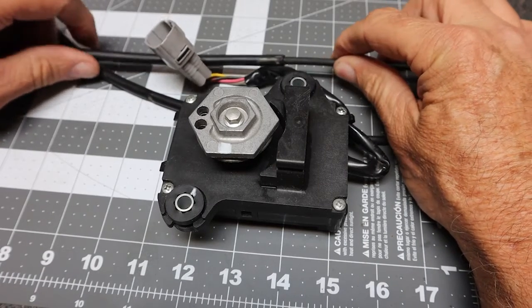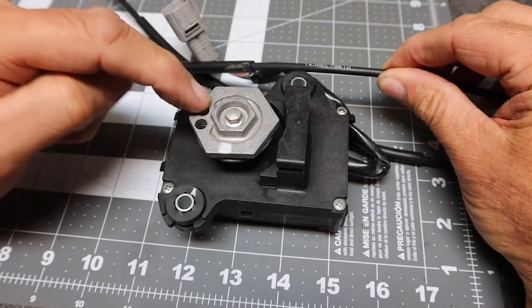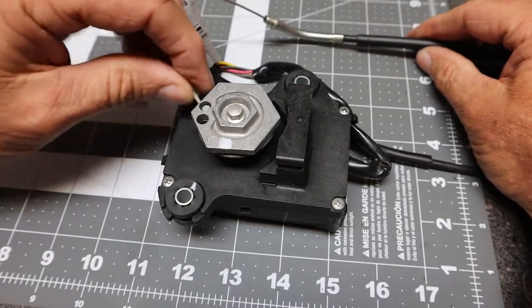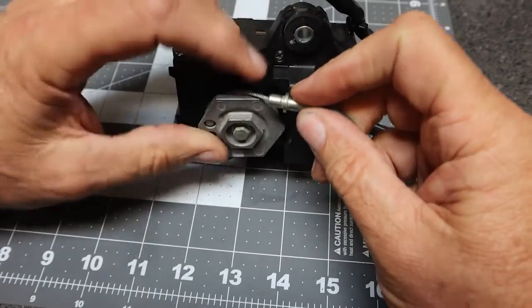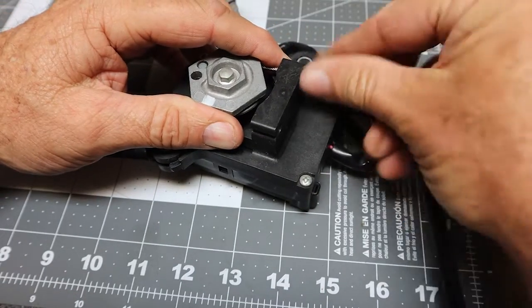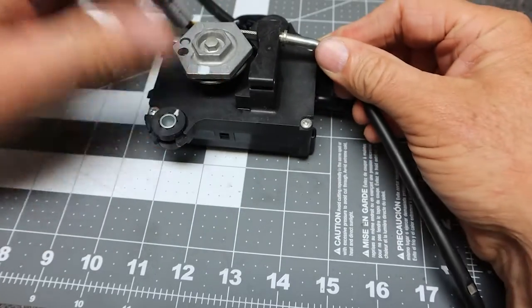Okay, now let's reconnect the cables to the servo. This is the 14J0CL cable. It goes to the top, or the upper cable connector. What we're going to do is slide that into the slot from underneath, and then wrap the cable around what looks like a little spool area here, and down into a slot there. So we're going to mount that, and there's a little retaining clip that we will put on once we get both cables on. I'll show you how that's going to go.